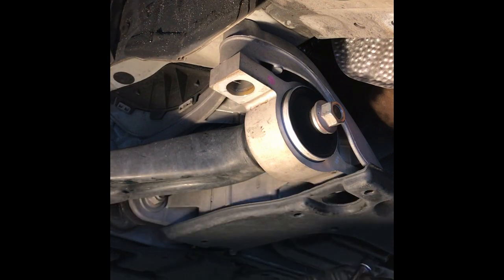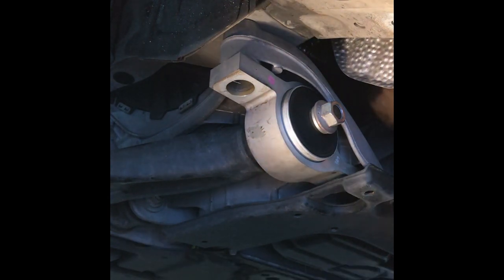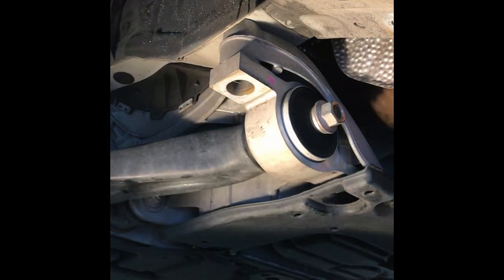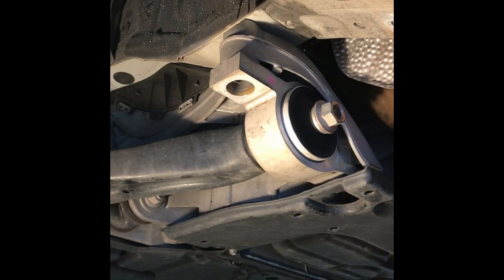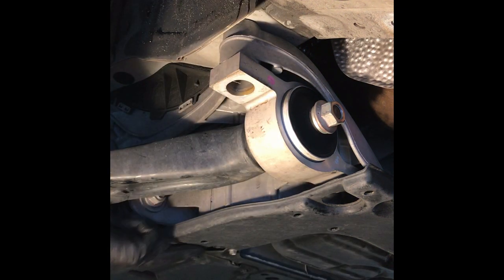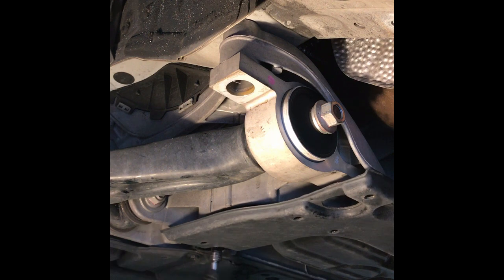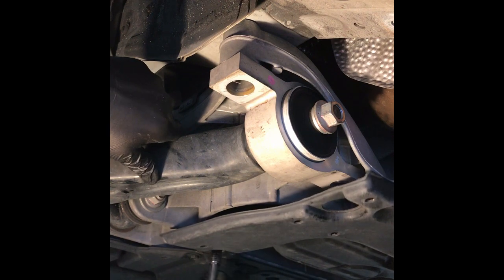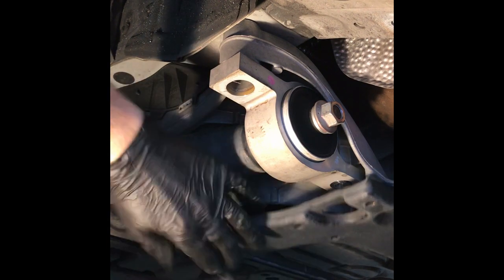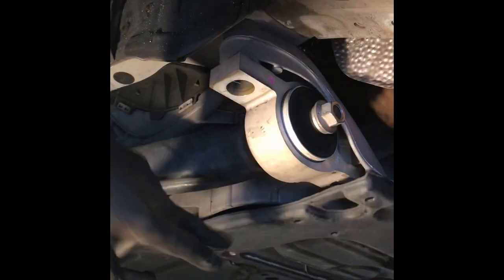So what I've done, I take two off. I know everybody wants to take the least amount of parts off their car, but to drop this pan out just enough to get it really out of your way, you take this one out, and this is again a number 10, and then there's another one right over here, kind of behind, you can't really see, another number 10. They're just little screws, and you can see it's just a plastic pan, nothing to it. Once you get it loosened up, you go ahead and pop it out, and that will let you pull the whole bushing out once we get this last one out.